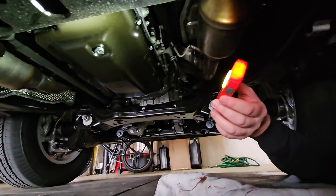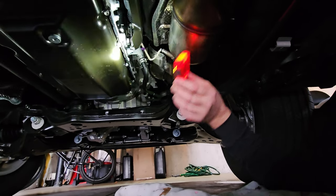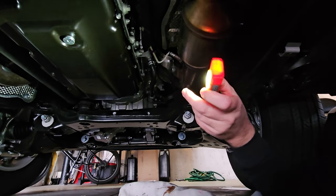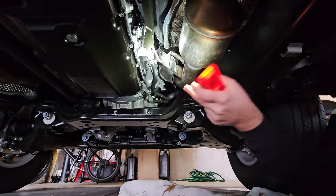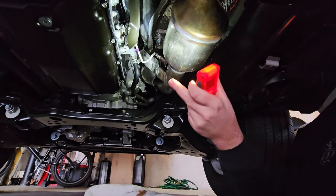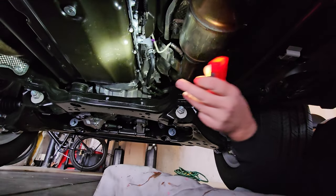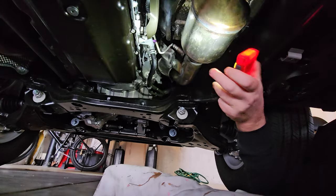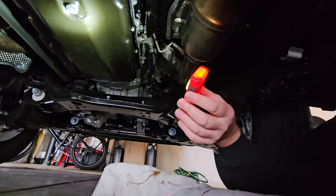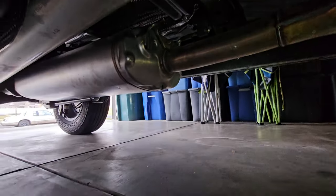What you don't see on this exhaust system is a gasoline particulate filter. These are not gasoline particulate filters — these are catalytic converters. If they were particulate filters, you would have monitoring lines — little vacuum lines that would go on either side of the particulate filter to monitor how much particulate has filled up and to monitor airflow. And sometimes on the diesel side, it would have an actual diesel injector on one side of the particulate filter to spray diesel fuel in and help bring up the temperature during regen. Again, we don't have any of that here. This engine does not utilize a gasoline particulate filter. After the pre-cats and the two main cats, that's it — it goes back to a wide pipe and through the muffler, and there's nothing else on this exhaust system.